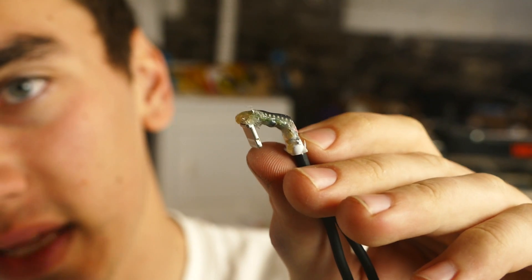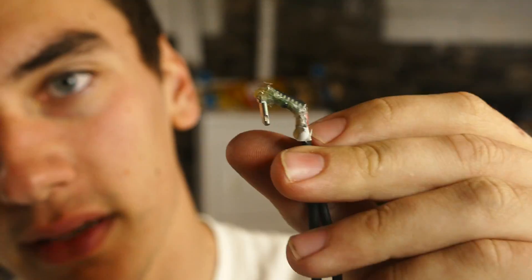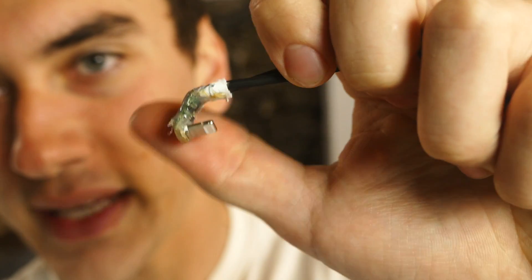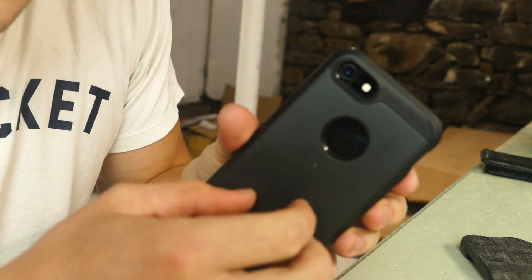Guys, so actually this second case turns out it's super easy to make. All you have to do is take the dongle adapter and just cut off the case with a dremel. All you need to do this is a dremel and hot glue, and you can make a pretty decent headphone jack case comparable to the $100 ones you can buy. All you have to do is cut off the outer sheath of the cable. The only other tricky part is you have to cut off one side of the connection to the lightning adapter, because you know how the cable is reversible — just cut off one side and that will allow you to actually bend it into kind of a hook shape.